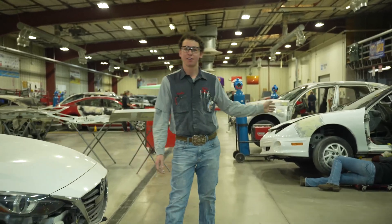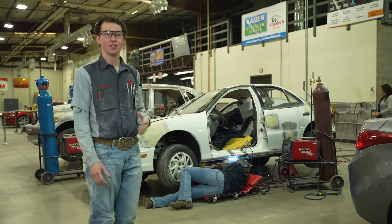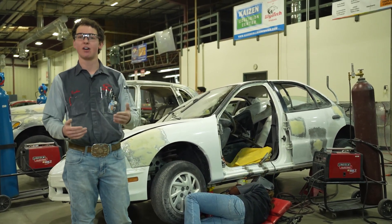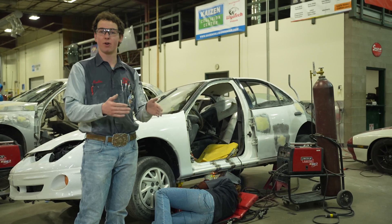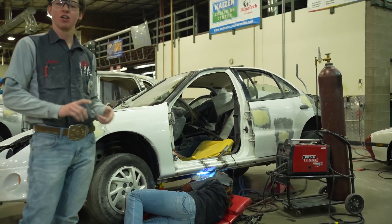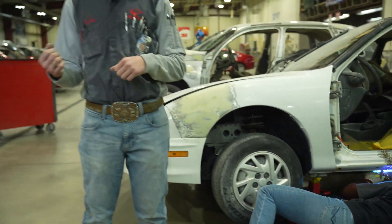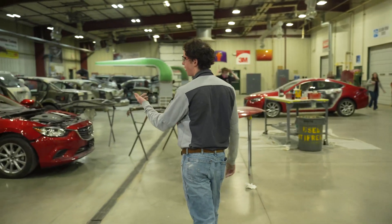Right here someone's working on a rocker panel sectioning. For me personally, this was one of the coolest projects to do — it definitely took the most time. What you do is go through and section out both sides of your rocker. It's kind of like a collision replacement: if you get hit on the side, instead of replacing the entire body, you section out the damaged parts, fix that piece, add your inserts, weld it all back into place, grind it, and put your body filler back on so it all feels as the original. Then the best part is your instructors get a really big smile, grab the biggest sledgehammer in the shop, and take about seven hits onto your rocker panel.